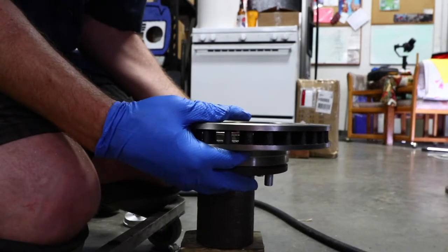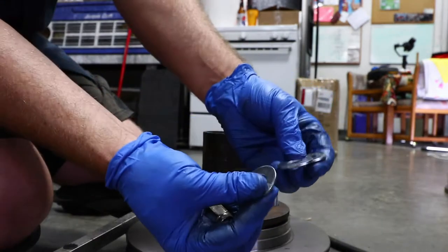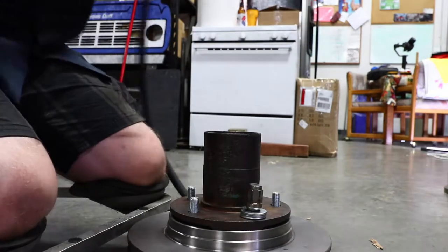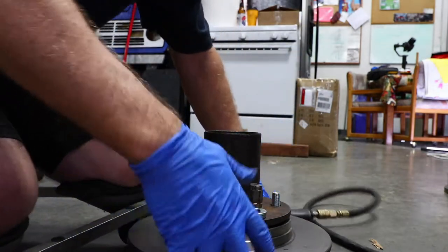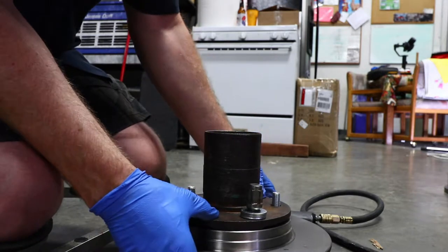It's a little loose still. The way you tighten it all the way up is to use three washers and an impact gun. Once all five studs are tight, it'll stop making noise because the hub will be seated 100% to your rotor.